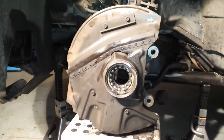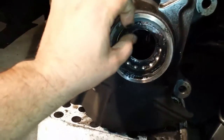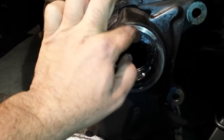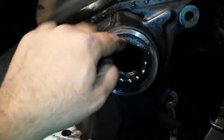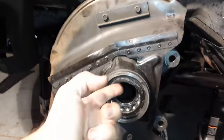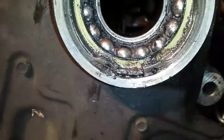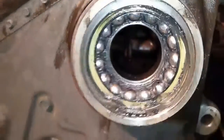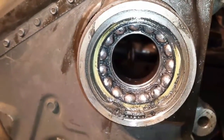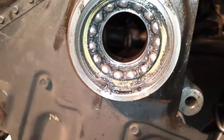And I'm going to take the bearings out. Actually, that's not how you usually see the bearings. That's some of the seals that came off when I took the wheel hub out. So I just took it out. Now I'm right here, and as you can see, there is a little clip that's holding it inside. Of course, it's with pressure in. You can't just move the seal and have it come out. I'm going to move that seal.